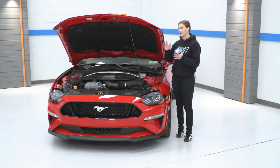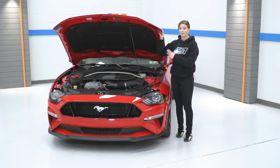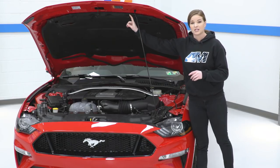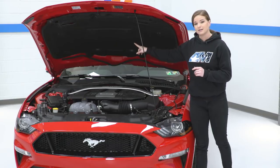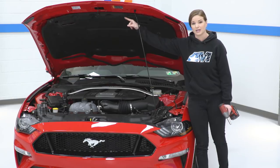The first step of your install is obviously gonna be to pop your hood. We do have a few things to transfer over to our carbon fiber hood from our factory hood. We need to transfer over our latch as well as the nozzle, so we'll be removing both of those. I have a 10-millimeter socket here and we're gonna go ahead and just unbolt that now.